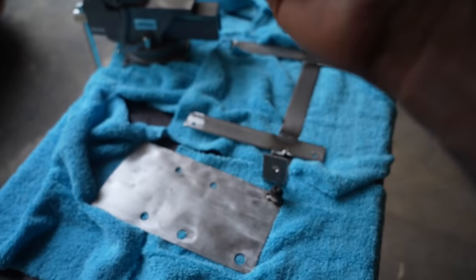Anyways, back to our project here for the meth. You can see the cable fits exactly like OEM. I may wrap this cable as well just to make sure nothing interferes with the heat and whatnot. Other than that, this is connected. You will notice that there are two reds that went through there. The reason for that is that the solenoid also takes power from here, and then the solenoid goes all the way to there. And the black side of the solenoid is the one that you connect to the brown and white. This is the brown and white that comes from the AEM controller. So I just tacked it in there. It's not in the way, and it doesn't disturb anything at all. So cable management on that side, I don't care.